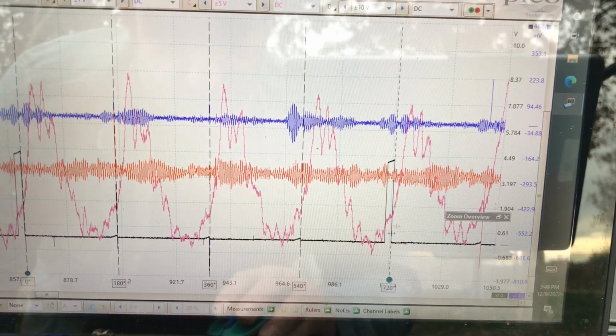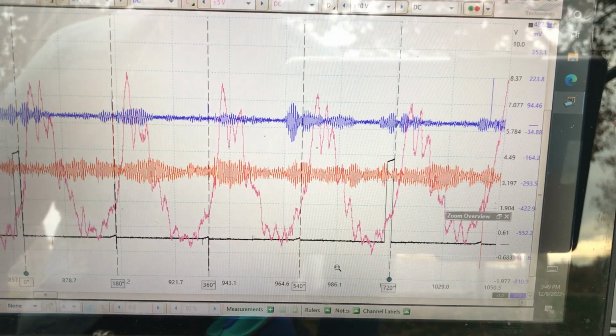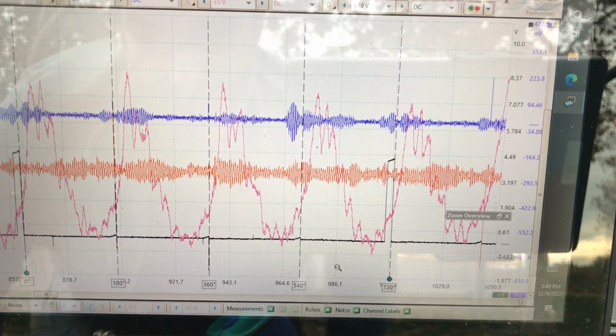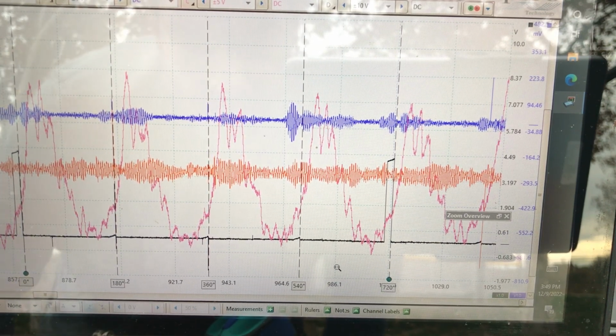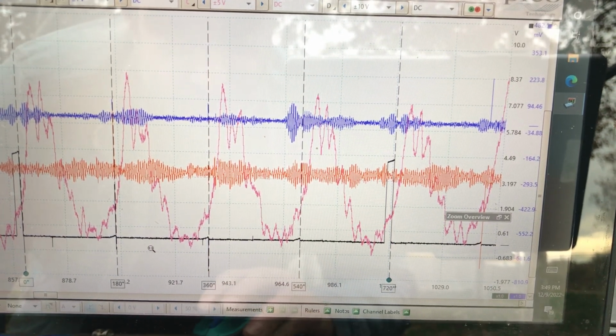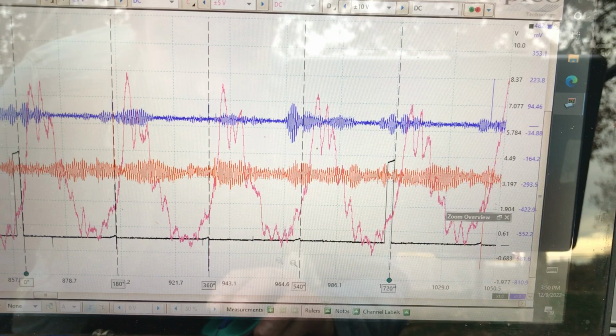But see, with this kind of technique, there are overlays. I didn't use one here, but an overlay would be that much better, because then you get to see everything, and you'll be able to look at what cylinders are on what stroke. There's a freebie online called a waveform overlay, and there's one called Drivability, guys. It's $20. It's got great coloring. I bought it. The colors on the freebie aren't as vibrant as the $20 one, but it's your free will to decide what you want to do. But an overlay would be phenomenal in this technique here, knowing what cylinders are on what strokes.